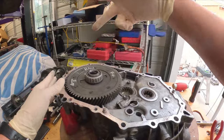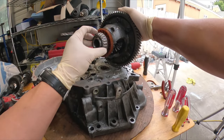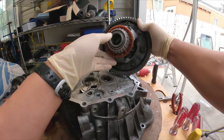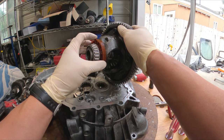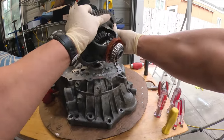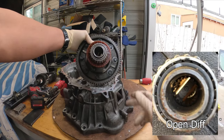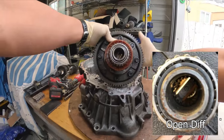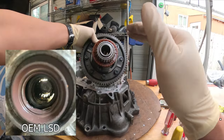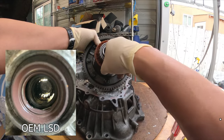To get the diff out, it's pretty simple — stick your finger in and lift up. The diff has two tapered roller bearings, one here and one over here. This big ring is the final drive, bolted to the differential. This orange-ish ring is for the vehicle speed sensor. If you look carefully, there's a rod in here that looks like a double lock on a door. If you can see through the sides of it easily, that means you have an open diff. With the factory LSD, those holes are much smaller — you can still see through, but not nearly as much, and it won't look like a double lock on a door.